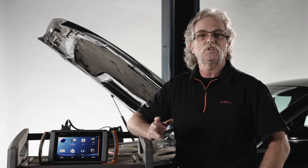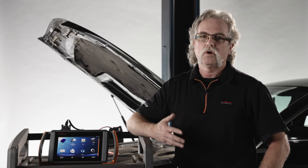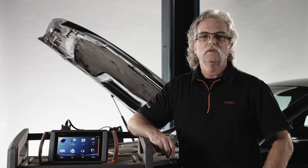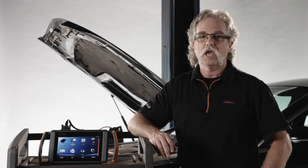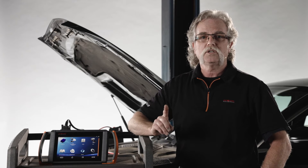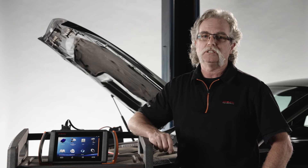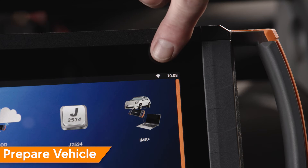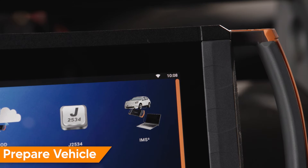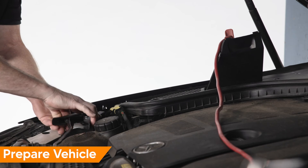When commissioning a new sensor you have the option to extract data from the old sensor, also referred to as the ECU. This is the preferred method if the original sensor still communicates. If using this method you will want to leave the bumper cover removed until commissioning is complete. Before beginning be sure you have a stable internet connection and have the latest Mercedes-Benz software update installed. Connect the vehicle to a suitable power supply like our PSM2.